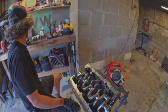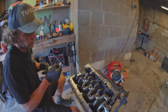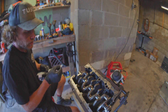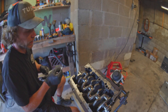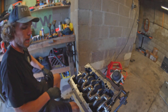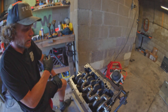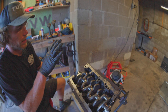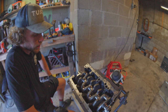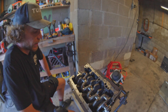According to this Plastigauge, it's very close — most of these are closer to the .001 than they are to the .0015, and it could be that they're .0012. Maybe I'm being a bit neurotic, but that's concerning because it's pretty close to being too tight of a tolerance. Not what I was expecting. I might pull everything out and clean it all, because if there's any amount of dirt underneath these bearings, that'll increase how tight it is. Or the other possibility is just the ARP hardware clamping down on things.